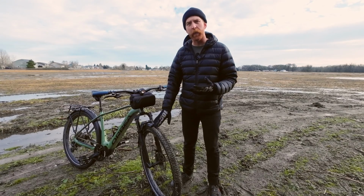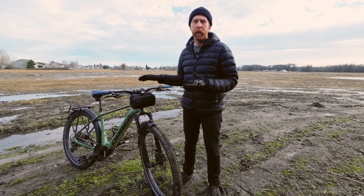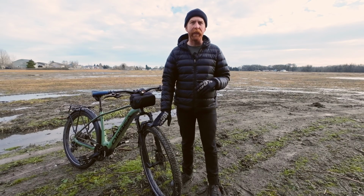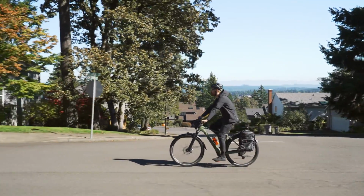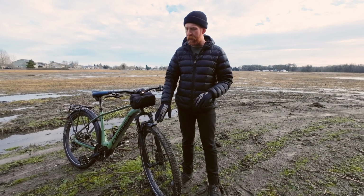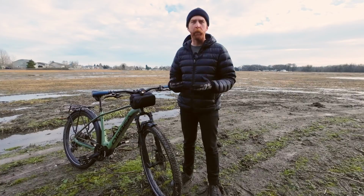As we look closer at the tire, we can see a very uniform center tread pattern, two lugs right down the middle, evenly spaced all the way around the tire. Now that is done specifically for the SUV aspect of this bike, a bike that will spend a lot of its life on pavement, but also is spending a lot of time off-road. Those evenly distributed lugs will offer good efficiency and good rolling speed, so minimal rolling resistance when it comes to riding on the pavement when you're very upright. But unlike a smooth road bike tire or a smooth city urban tire, those deeper lugs down the center will offer more traction and grip and control when it comes to riding off-road.